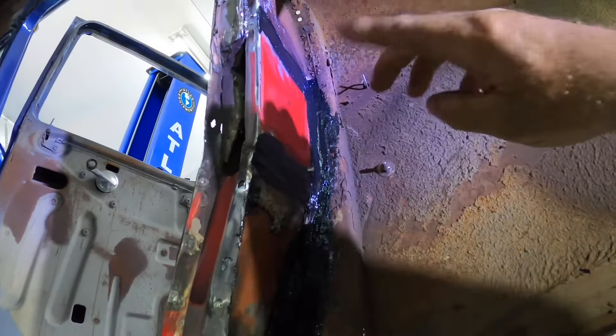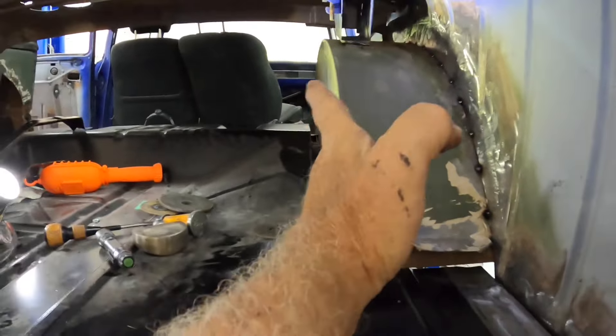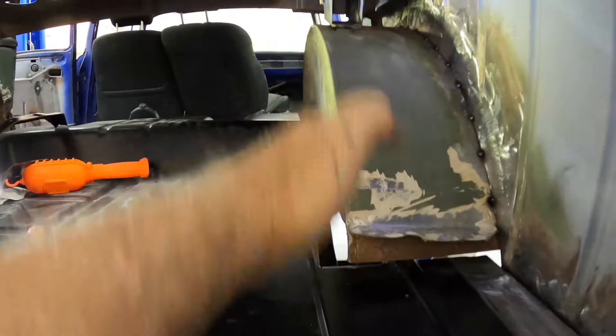Put the tub in next. I've got the tub sitting in position. The tub was actually lower than the original tub - that's where that was. So we're going to have to take this off. We've got it flat this way and the front edge flat. We're going to attach this section here back on to the floor pan, and then the tin work will attach to that. I'm going to do that first. When I get that done, I've got to build all that again - which was all rusted out. All that gets attached to the tub and it'll look way better. Let me get into it.